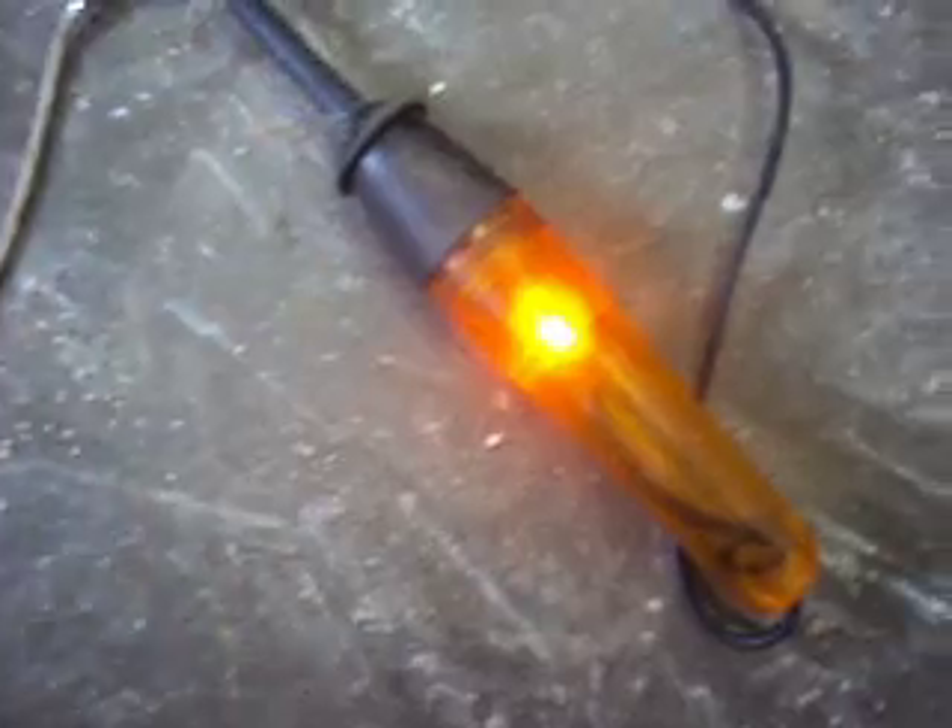The yellow lead — I've got a low amp probe I'm checking. Before I even checked this, I checked it out with my Vantage. The test light here draws about 83 milliamps to keep it lit, and I've got some pretty light-duty wires, so I might even be losing a little bit through these little test wires. I saw a video that you could measure parasitic draw, and 83 milliamps is about a fairly normal parasitic draw of what you find on cars nowadays.